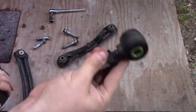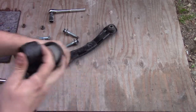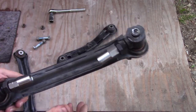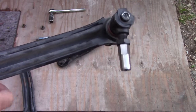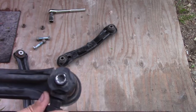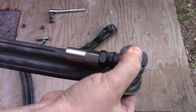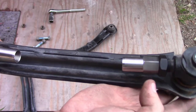Now if you remember a few videos ago, we were powder coating these end links, and now you can see exactly what they're for. So let's just use our bolt already there. We'll set these things up on the link. Make sure that one is the one direction. And we want to try to make sure we shouldn't have to be adjusting them very much. So we'll put a little more threads in the tube nuts. So this gives us our guaranteed width. Then we'll just have to cut that length. Pretty simple.